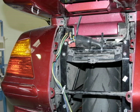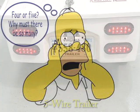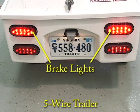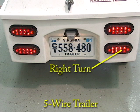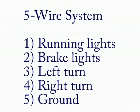Now, before we get to the installation, I want to explain a topic that leads to a lot of confusion. In order to install the right wiring, you need to know whether your trailer is a 4-wire or a 5-wire trailer. Most trailers manufactured in the U.S. and made specifically for motorcycles are what we call 5-wire systems. That's because they have a set of brake lights that operate separately from the turn signals. This would include all the trailers we sell — Escapades, Timeouts, Minimates, American Legend, and so on. This matches how your bike is set up. Your bike has a brake light that operates on a separate circuit from the turn signals. And when you add up the signal circuits plus an electrical ground, that's 5 wires.